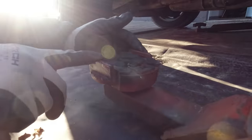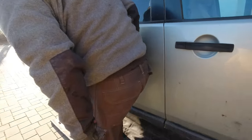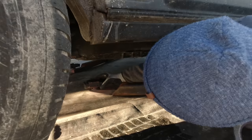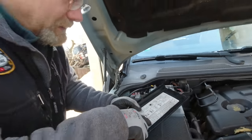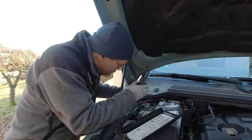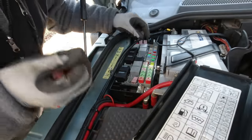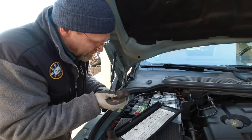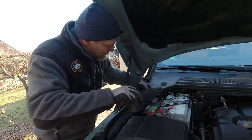You can see I got two sides welded on here, so this is hugging the frame nicely. It's frozen in - that does happen. We need to disable the parking brake module because once I start pulling plugs on it, it may actuate and break the new module right away. So it's a good idea to take that fuse out. We're also going to disable the air suspension because when we lift the car up, the air suspension is going to wake up and do crazy stuff.